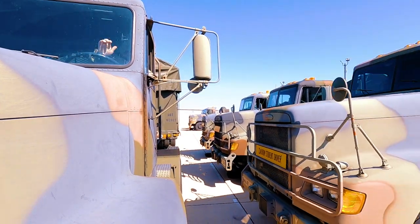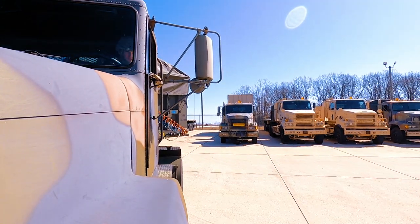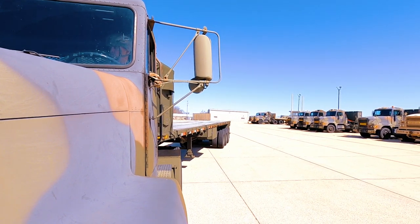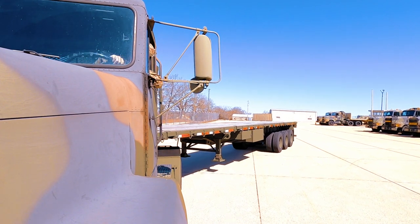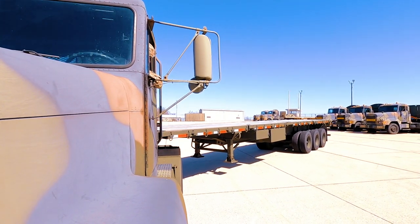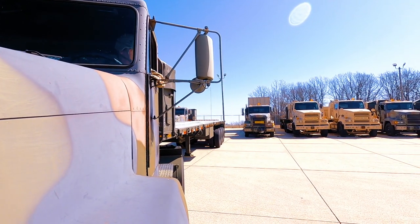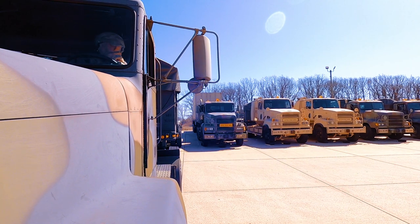Backing is a perishable skill — the longer you go without practicing it, the less proficient you'll become. It's important to keep this skill and practice with as many types of trailers as possible, because during a mission task you may be parked between two pieces of equipment, between two walls, or in tight spaces with objects you don't want to hit. The more proficient you become, the faster and safer you can conduct the task. Knowing how to identify reference points at the rear of the trailer helps you get closer to the alley dock ramp so that personnel can safely move forklifts, vehicles, and pallet jacks from the ramp onto your trailer. Even while ground guiding, you need to know how to communicate to the driver so the trailer goes the intended direction.